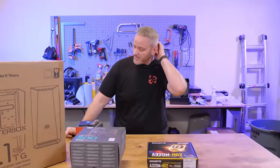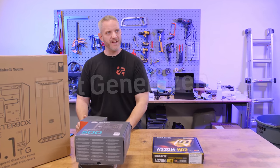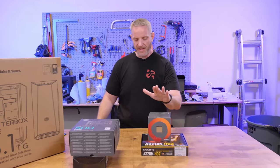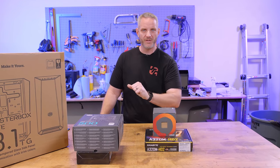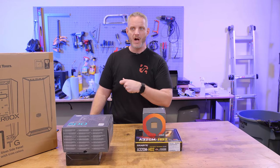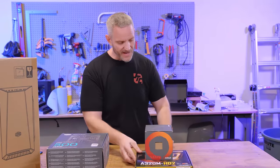Because this is a first-generation Ryzen board, to keep it as compatible as possible I'm putting in a first-generation Ryzen 1300X. It doesn't have an iGPU in it, which is perfectly fine because we'll be putting a discrete graphics card on here. That way, when they're streaming Netflix or any other streaming service, the decoder is going to be able to handle that. And since there's no iGPU, we have to put one in anyway. So the 1300X is paired with the A320M.